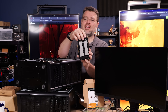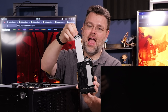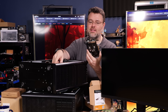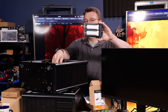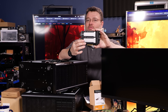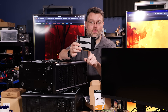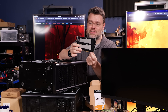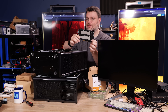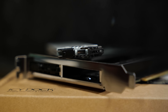This is a full-height PCIe card. Remember the 5¼-inch bay I looked at a while ago? This is the same thing except in an M.2 form factor. If you're going to use this, your motherboard needs to support bifurcation because you're going to have to put your PCIe slot in X4/X4 mode. If it goes into an X16 slot, it'll be X4/X4/X4/X4. If it goes into an X8 slot, it just needs to be X4/X4. You've even got LED headers — it's a hallmark of quality.